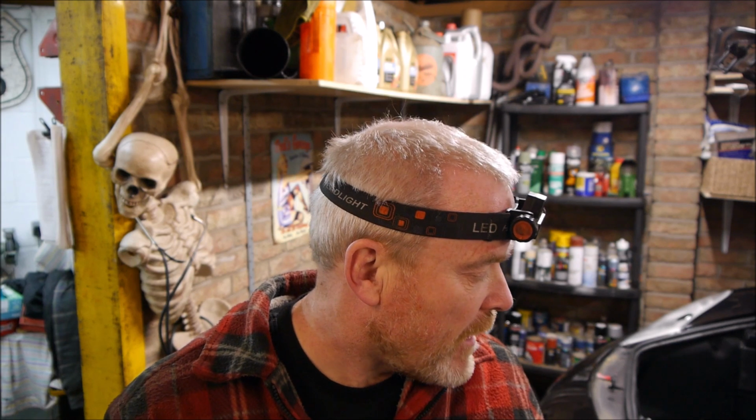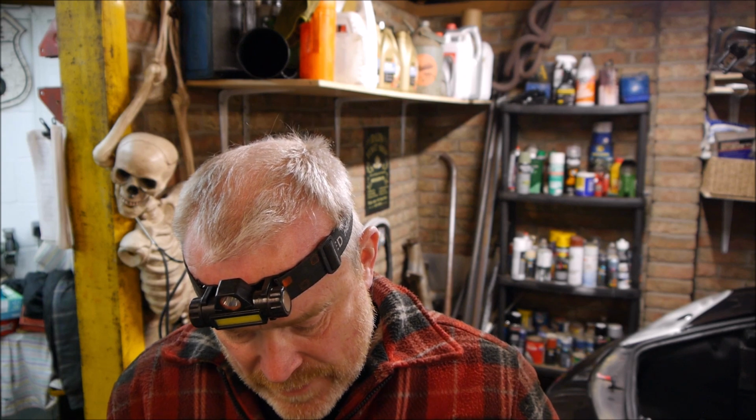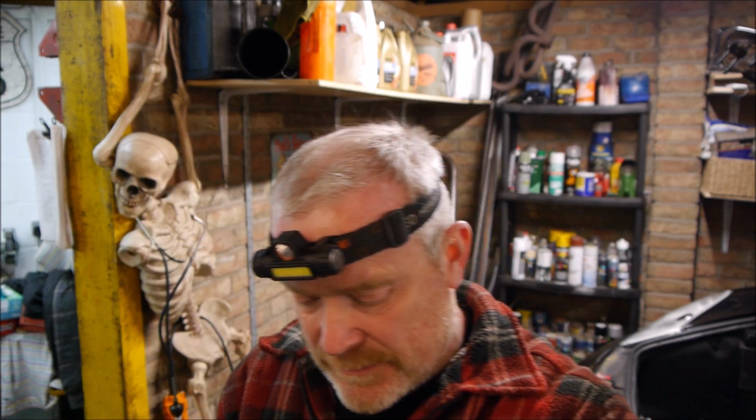Moving on to the discs now. What we're going to do with the discs: the discs are cross drilled and vented, so I'm going to drill the holes out on them because they're corroded and some of them are quite bunged up and blocked up, so it's going to help the performance. And we're going to fit EBC red brake pads, front and rear. Now I found these to be really good on the Boxster. I haven't had the red type, to be honest, EBC.